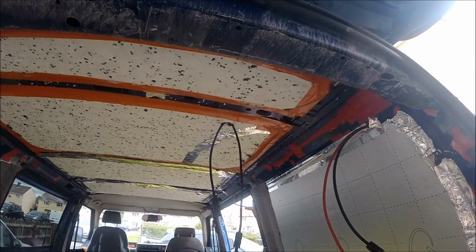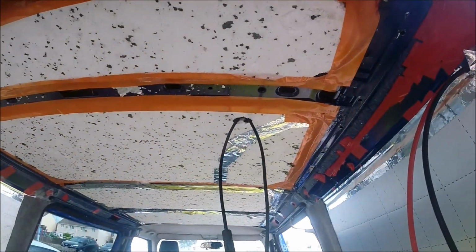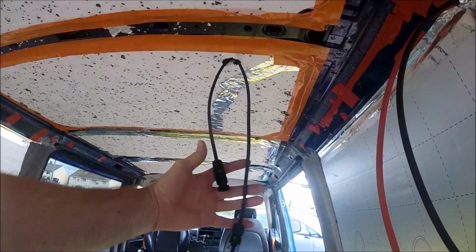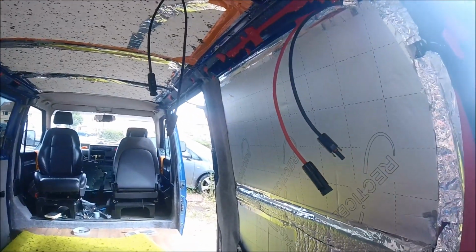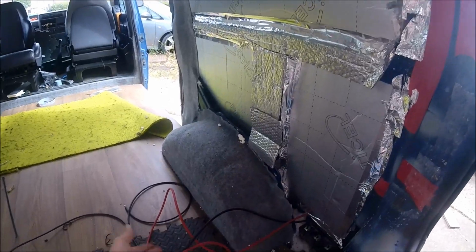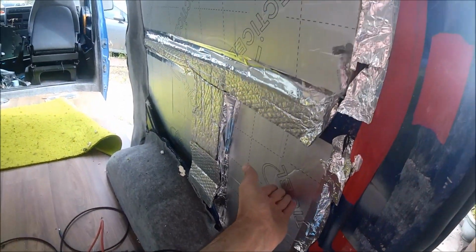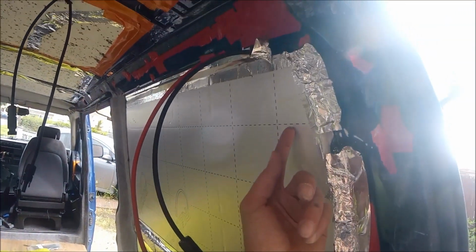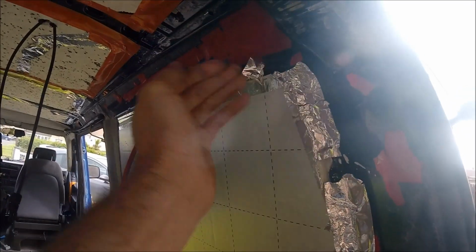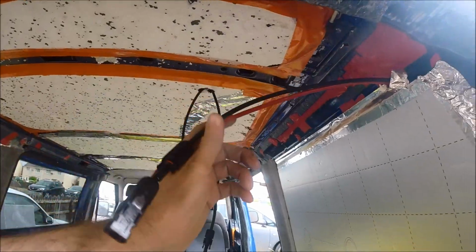Right, so with the panel mounted to the roof and the cables fed through the roof via the waterproof IP65 junction box, this is the positive and negative coming from the panel. I've then run part of the 5 meter extension cables, that will be linked below, all the way beneath the insulation panels, going up through that little brace above this insulation panel, and it's just coming out the top here. This is all going to get tucked up behind the headliner when the headliner's all in place.